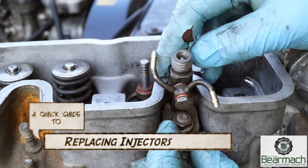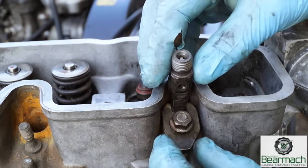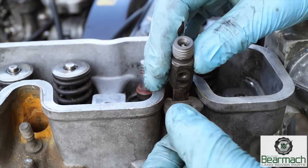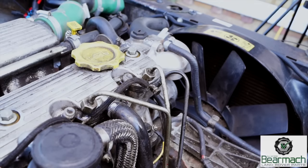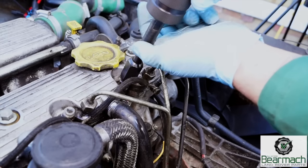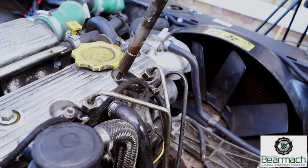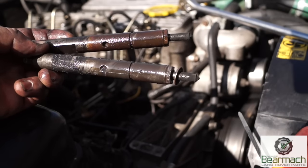Basically injectors are clamped down and you have to remove the piping off the injector first — this is the leak-back pipe — before you can remove the injector. I'm undoing the M8 nut and then lifting the clamp out. It should allow you to lift it out without lifting the injector. Sometimes you'll find that the stud will come out with the clamp as well, which is not a problem — just take the nut off it and put the stud back. The only proper way to remove an injector is with an impulse extractor. Screw it onto the top of the injector and then use the slide hammer to knock it out. Sometimes these are carboned up and very difficult to remove. There is no way of telling how good an injector is by the condition of it from the outside — it needs to be tested.